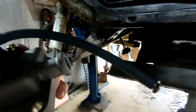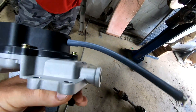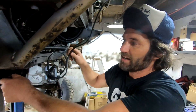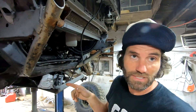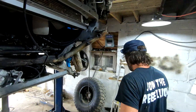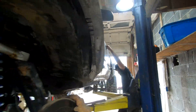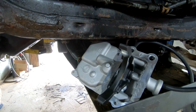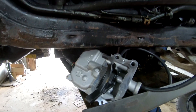Just to prove that this is going to work, I haven't really had a successful testing of the 4WD system yet. So I'm going to plug this in to prove that it works before I put this all back together. I got to run this vacuum line — I haven't done that yet. That one's not going to be long enough. Give me a nice six-incher there. All right, I hooked up a vacuum line and plugged this in. I'm going to jump up in the truck and you're going to film this and tell me if it moves. I'm going to hit the 4WD switch and shift over into 4WD.